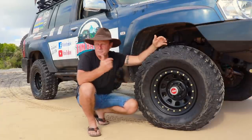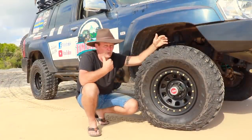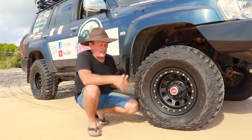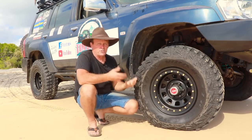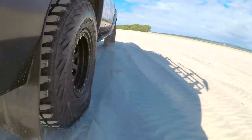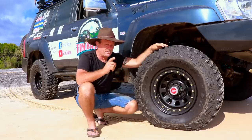The reason we get our tire pressure a lot lower when driving on the beach compared to, say, the high country — I'm a couple of PSI lower than I would be out there — is because you want that longer footprint. That longer footprint allows your tires to sit up on top of the sand much more easily. If your tire pressures are too high, you're going to dig into that soft sand and potentially get yourself bogged.